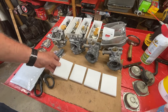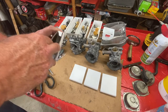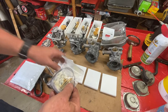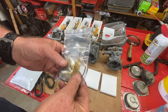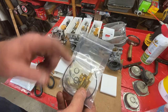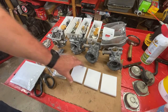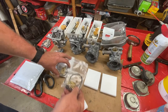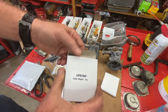Now let's take a look at these — they're from Niche Cycle, N-I-C-H-E, in St. Petersburg, right up the road. This is where I got the entire kit from, and I'll explain why I did this separately. This one comes with jets, emulsion tube, needle for the slide diaphragm — the whole bit. It has two different main jets depending on configuration, O-rings for the fuel tees, springs, and small O-rings most likely for the pilot screw. This is a VFR750F carb repair kit — I stumbled across it doing a Google search.